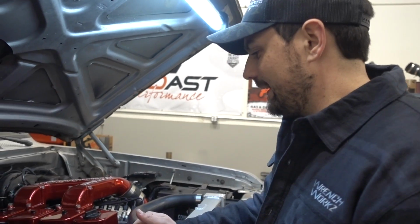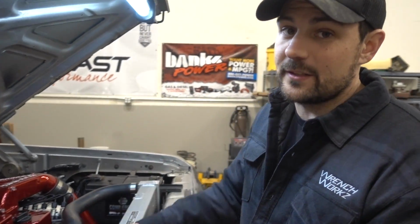Moving on, the turbos. Everybody wants to know about the turbos. Both turbos are from Stainless Diesel. They are both 5-blade turbos. That's why this thing screams. They are very, very loud. The sizing on them is a 68/83 with a 80/96/132. I believe it's a 1.0 housing on the manifold charger.